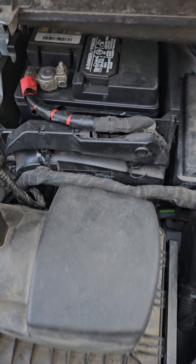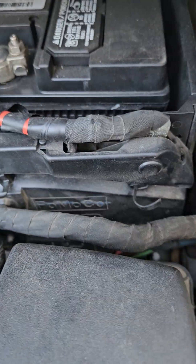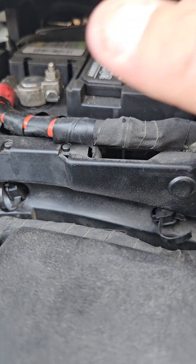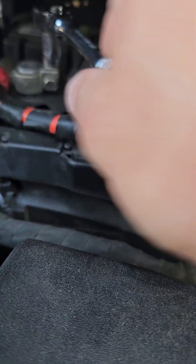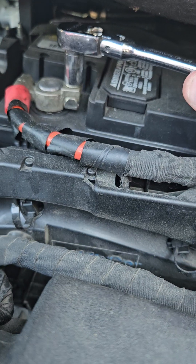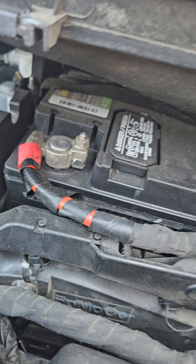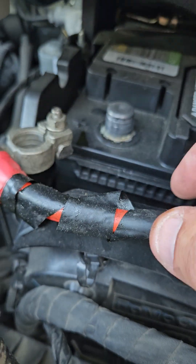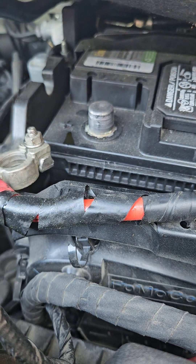Once you get the battery cover removed, undo the battery terminals. There's a bad design on Ford — undo the negative first, which is all the way in the back, so you have to reach way up under there to get to it. Then undo the positive — don't let it touch anything. Loosen the positive terminal, then lift it right off and leave it on the box so it doesn't short out. Leave it unhooked for about 15 seconds.